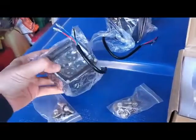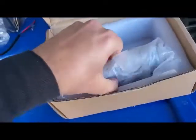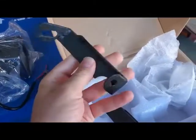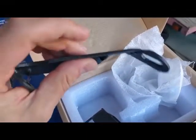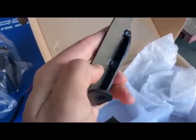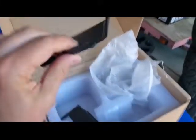So here's what we're doing today: we're going to try to make this light kit work. This is actually a Ram 1500 light kit and we're going to see if it will work on the TRX. The way it mounts is pretty simple. It comes with two mounts — one end goes under the hood so the lights go up and down at the hood, and the other end is where you mount the light. What's nice is a lot of designs just have a flat piece of stock that gets flexible and bouncy over bumps, but they actually gusseted it with this side plate — nicely welded there and on the end, with one spot weld in the middle. Looks like it's all powder coated nicely as well, so shouldn't see any rust.